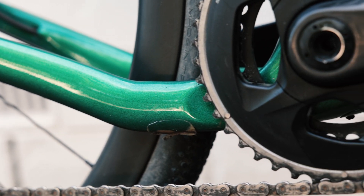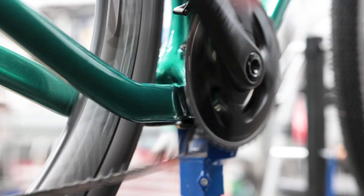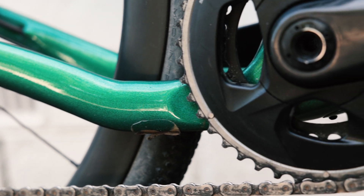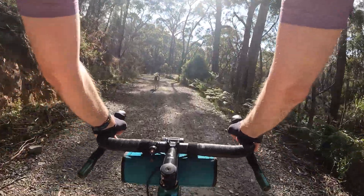Let's talk chain slap, because there is a decent amount of it due to how they've designed those very low dropped chain stays. I'm running SRAM Force Wide with a 2x chainring setup and my chain is already on the verge of being too short, so I really can't take any links out. Even with that, the chain impacts the lower edge of the chain stay quite a lot, whether I'm on the big ring or the small ring — go over bumpy terrain and the chain is banging into the frame. There's not much you can do about it, but if you get protection on that part of the frame from new, it won't really be a problem. It'll make a bit of noise, but it'll protect the paint and carbon underneath. Do that from the start and it shouldn't be too big an issue. Note that I'm not sure whether 1x drivetrains will be any better or worse for chain slap.